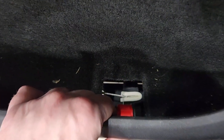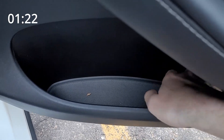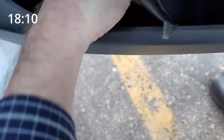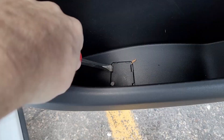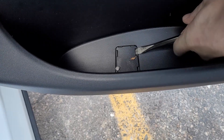You can see the little white tab to pull on this cable. Fairly easy setup. I do have a problem with this, because if you think about a lot of vehicles — especially if you have young kids — how much garbage can actually be jammed in that door pocket, making it very difficult to access that release in an emergency. On top of that, not every Model Y has this feature. This specific Model Y, manufactured in 2020, is very difficult to access. This plug — I can't get it out of the door pocket with just my fingers. I had to get a screwdriver, and even with that, it took a little bit of time. It was difficult.